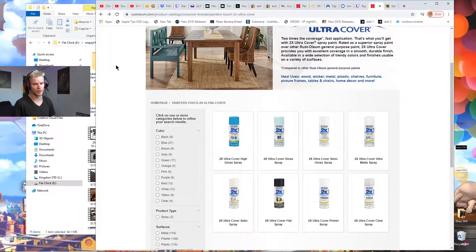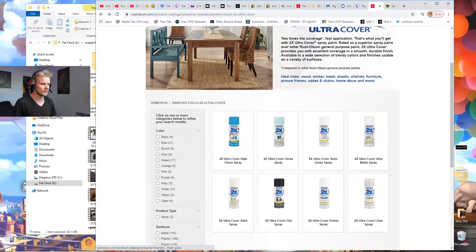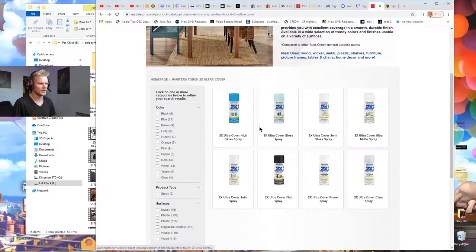Next, I'm going to be custom painting a G Pro Wireless and I'm definitely going to make a video on that. I just want to go over what kind of paint to use. For the colors, I'd recommend this brand — the Painter's Touch 2X Ultra Cover. They have it at Home Depot and Walmart, and it's meant for plastic. It bonds to the plastic really well and covers really well.